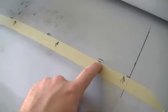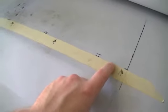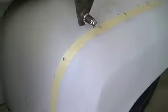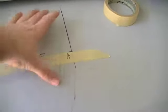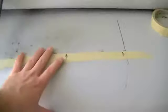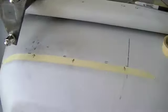I've got my marks made and double-checked everything — I had to make some new marks. Basically I've laid down this tape line and drawn some arrows to remind me which side of the tape I'm working off of. So this is going to be our baseline: we're going to measure 5 inches back and 4 inches forward to get the total amount of material we need to cut from this section of the fender.